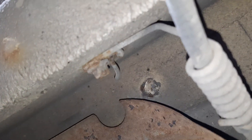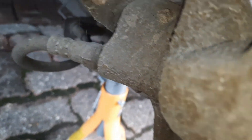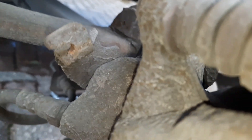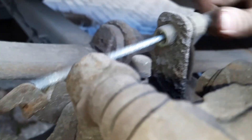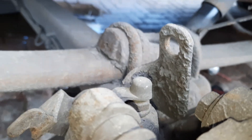We're going to pull this cable here and that will pop out of the bracket. It comes over this heat shield which keeps you away from the exhaust. You have to undo that nut there which is a 10mm — this keeps it up out of the way. And obviously you've got to unhook it off the caliper. When you've unhooked it off the caliper give it a good pull and it should come out like that, no problem.